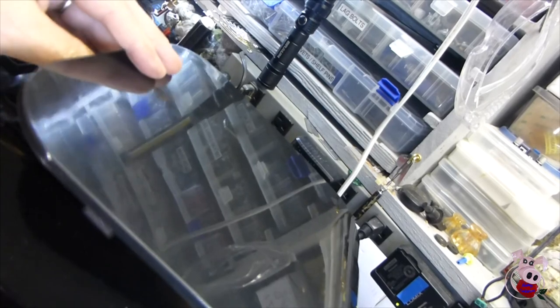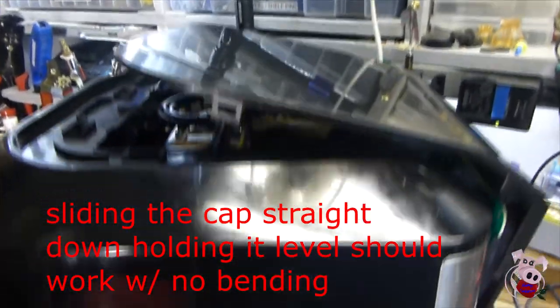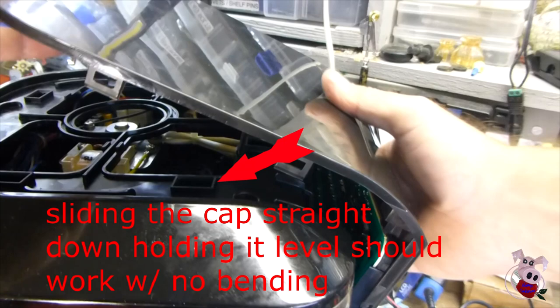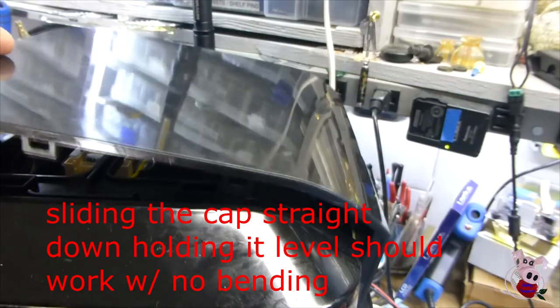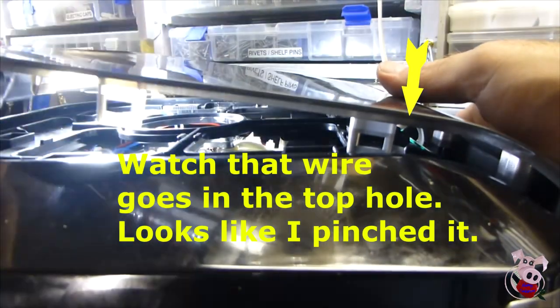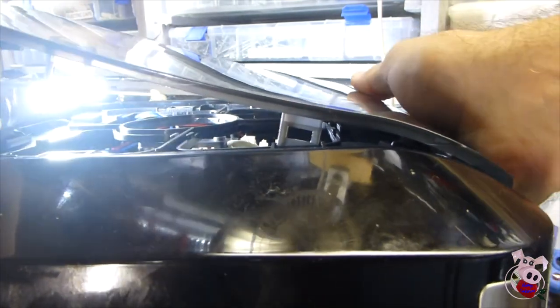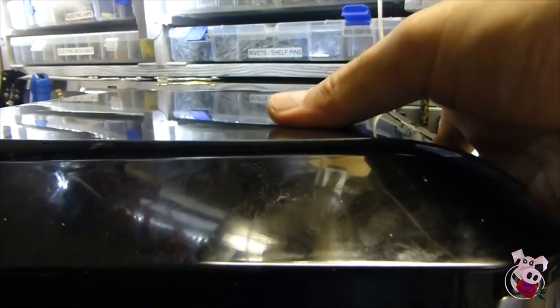Now align the front panel. Connect the wire coming through the top hole and make sure it is fully pushed together so that it is clipped. Rest the front edge brackets in the holes. Holding the front edge down so the brackets stay in the holes, swing the top over the face. As you swing it over, you need to get those first rectangular post holes into the holes, and remember that little bend you had to do to get them out — you'll have to do it again. Push the control board face into the unit so the top clips click in, then align all six rectangular holes on the top. Once you have alignment, you can turn it on to verify it powers and heats up, then push down and all six clips should comfortably click in.